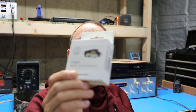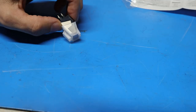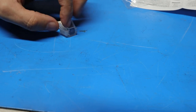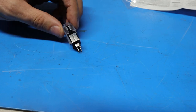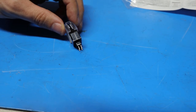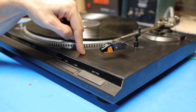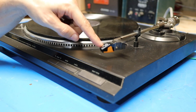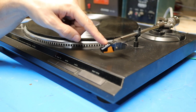To try and fix the problem, I'm going to replace my needle and cartridge with this Audio-Technica AT85EP that I picked up on Amazon. Here's the new needle and cartridge — not a whole lot to look at. There's a protective cover over it to protect the needle, and there are the pins that'll plug into the tonearm. This is a P-style cartridge. I've got the amplifier and the turntable powered off, and I'm getting ready to change my old needle and cartridge, which happens to be an Audio-Technica DR350.